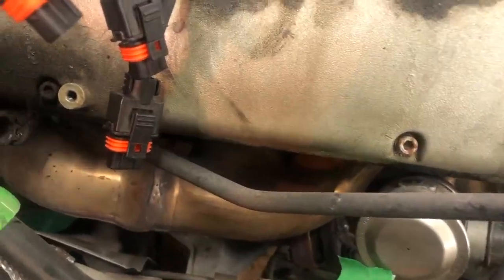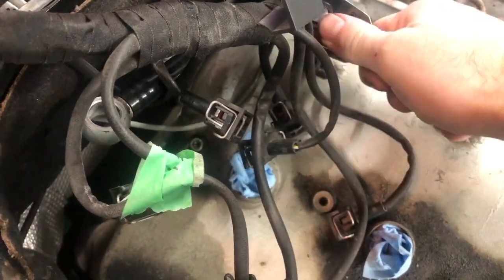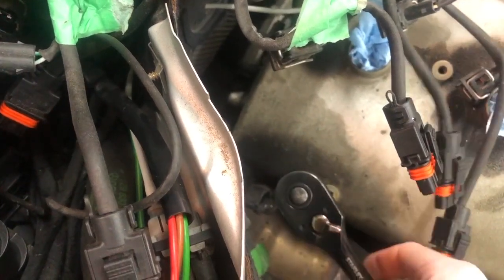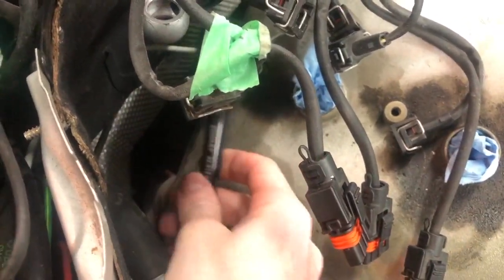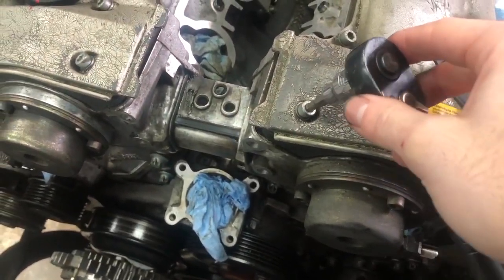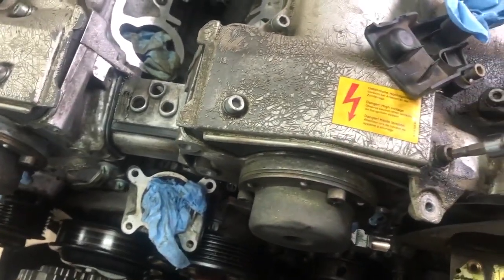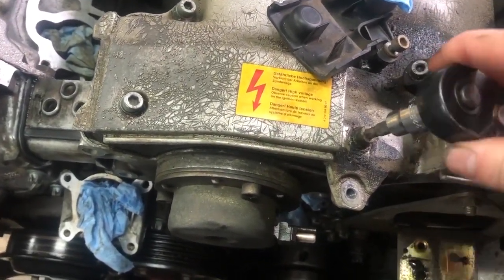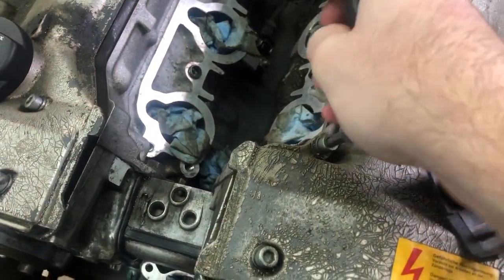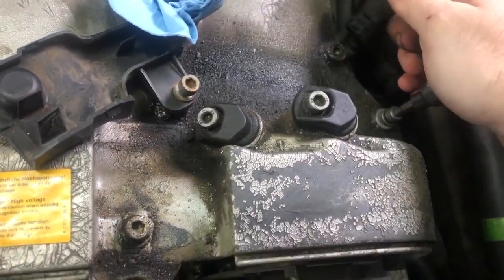That's the first one that needed cracking. What about this one? Loose - oh my god, like no force at all. What about this one? That's super oily. Oh my god, totally loose, totally loose. And finally the one back here - oh my god, not even tight. Unbelievable. No wonder it's leaking everywhere - those are less than one newton meter of torque. I want to try the right hand side, the passenger side. Look at that - I didn't even loosen anything. What is going on here? Barely any torque required to break these loose.